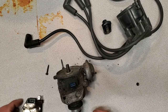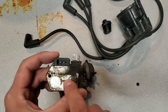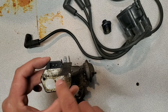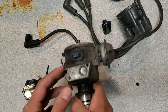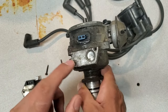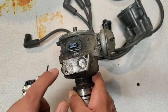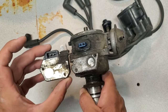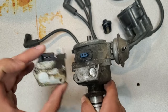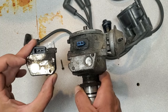After pulling the cap off and the module, I did notice that the module basically didn't have any more compound on the heat sink surface anymore. This is mostly just corroded aluminum, and if you look at the distributor surface you'll see that there's nothing here, which I think is quite interesting because normally I have to coat these with heat sink compound material so they don't get too hot. This one didn't have any left, which is very interesting — not that this was a problem, as this module was working fine, but I'm sure it wasn't helping.